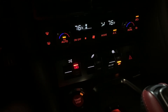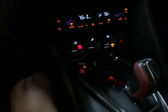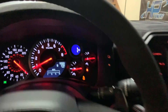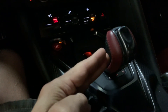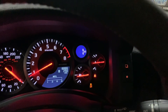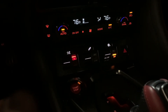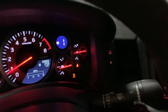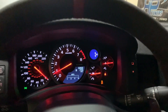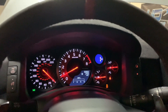The next thing you need to do while doing your pull is make sure the car is in manual mode. When you pull your shifter back it will go into the last mode it was in — it defaults to auto mode. When I push over on this it actually changes the shift mode up here. Be careful, because on the CBA cars this will sometimes reset your drive modes. It needs to be in manual mode. Usually I'm going to ask you for a third or fourth gear pull.